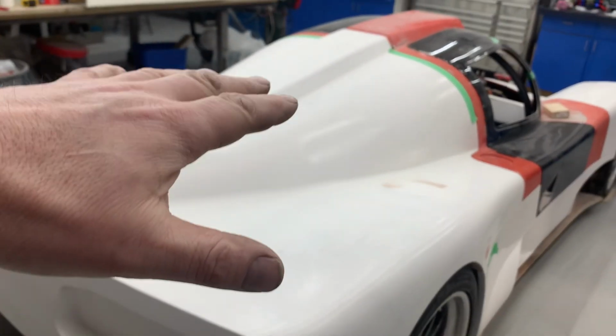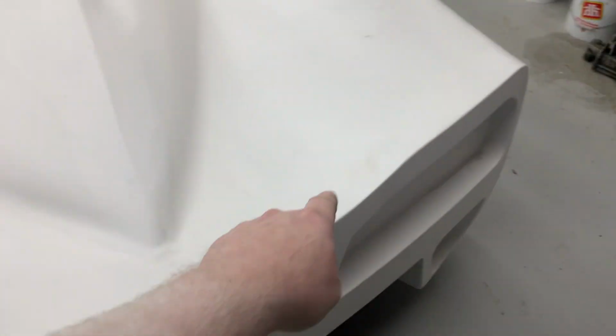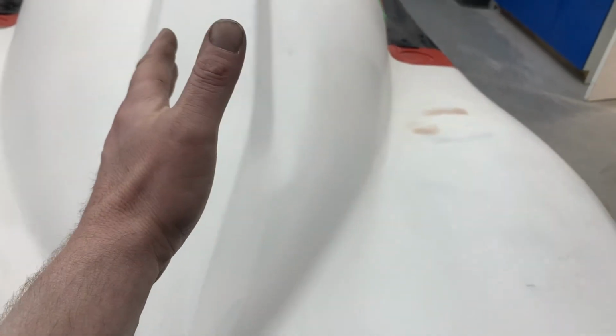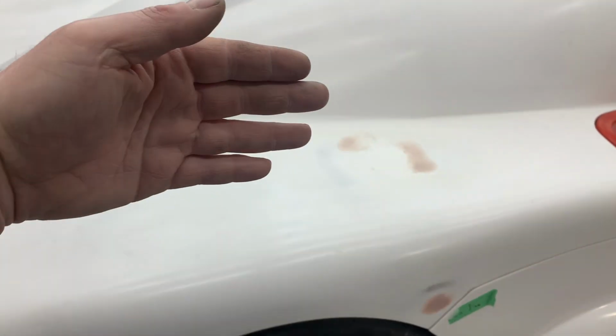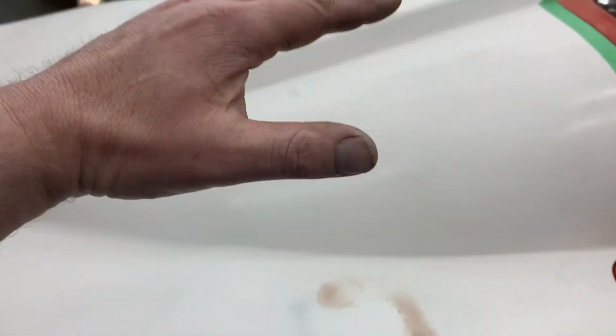This thing's so heavy to move around while you're making the mold, because we'll have 5 sections to the mold. So we'll laminate the main top surface, so there'll be a flange all the way over the edge, back along here and along here. That'll be the first part of the mold. That's nice and simple. We can lay that up in trestles, but when we've got to index the mold this way, because we've got to laminate the side, how do you do that without some form of a simple rotisserie, without disturbing it? Because the last thing you want to do is disturb this, because if you disturb this and that part of the mold starts to separate, then you're goosed. You've lost it. You're never going to clamp it back down to make the rest of it. So it's never going to be the exact shape again.